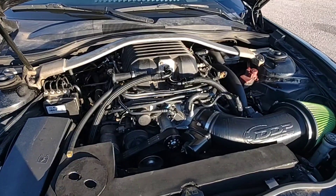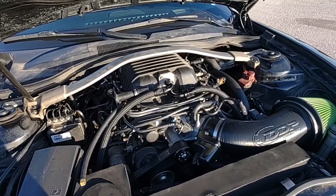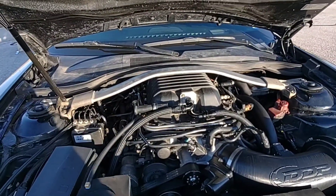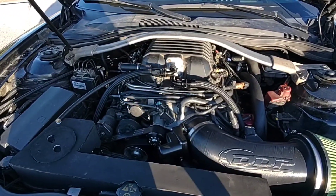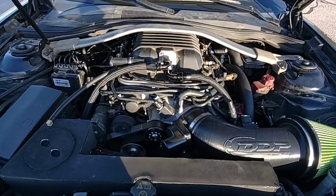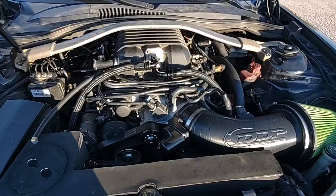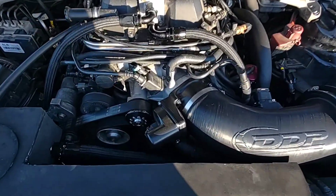But for those of you that do short racing, straight line racing, or just cruising down the road, it's the best way to cool your car — there is no better way. One of the issues that caused us to start doing this was I used to have a five gallon tank in the trunk with a Stewart EMP pump. The temps I was seeing in the tank versus the actual intake were about 20 to 25 degrees different. So you could get nice 30 degree water in the tank, but you would only see 50 degree water, 55 degree air in the blower — you're collecting heat over that distance. I actually did away with the EMP and used the stock ZL1 pump and I'm noticing my intake temps rise at the same rate as they did with the EMP. I don't see a reason to use an expensive higher flowing pump if your intake temps are going to be the same or warmer.